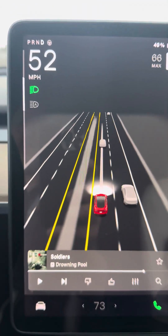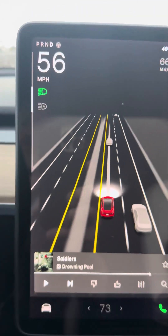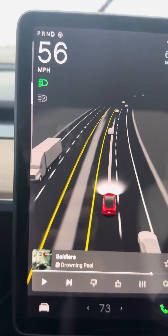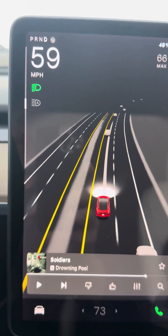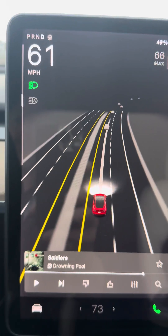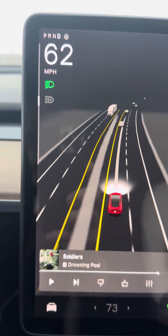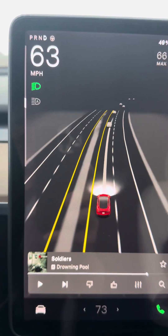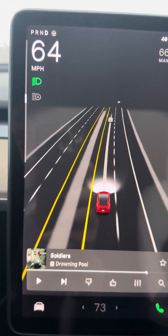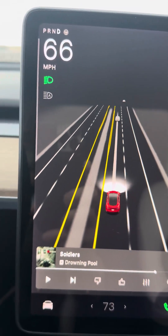At the top of the screen you'll see that white bar. If I give it a little oomph, you'll see it grows — that's your draw from the battery. And the green is your regen going back into your battery. So if you're driving around and you're stopping at a stop sign or stop lines, and that green bar's not growing, you need to extend your braking distance. Extend it out a lot further so that you're using your regen braking instead of your physical brakes.